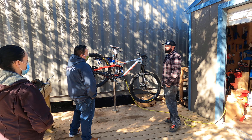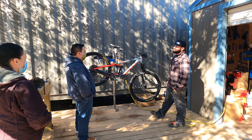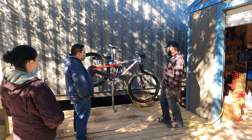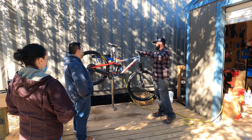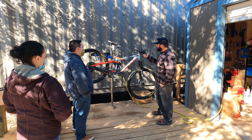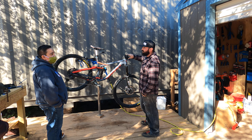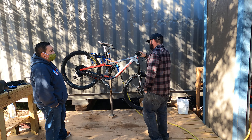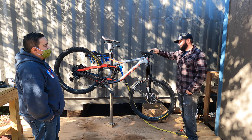Today we're talking about freeride brake inspection — you don't want to be stuck out on the trails with no brakes trying to get back down. The first thing you want to do is check for compression. If you have zero compression, you're going to have an issue with your levers; there's probably air in your lines which you need to get out in order to be able to stop. As you can see, we have compression in these lines.